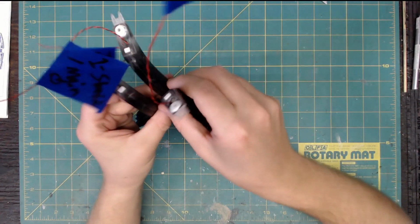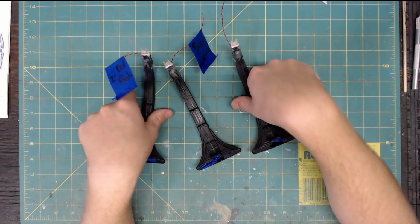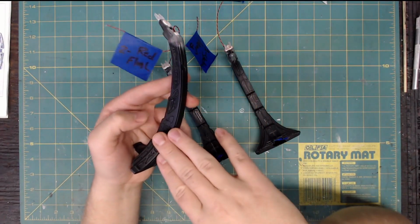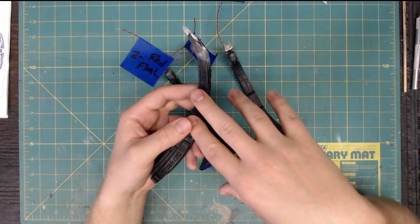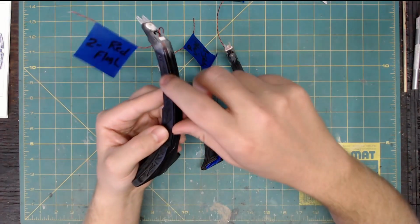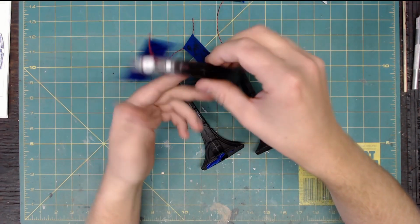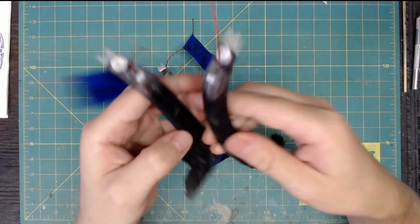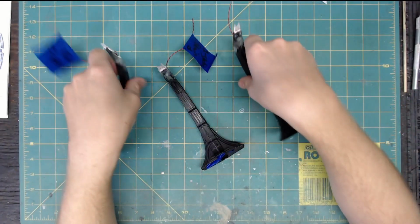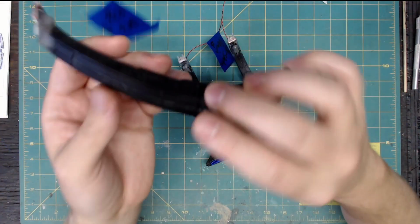Then we'll put a coat of gray primer on there. Why put gray primer after we've primed it with all that other? Because the paint we're using works best on the gray primer coat underneath it. I've already experienced that, and it really does work the best with that gray underneath. So we will put the gray primer on after we get everything light blocked and ready to go. And then we'll sand it again, get ready for the base coat, get a nice finish on it, and then we'll move into the base coat color and get that looking good.